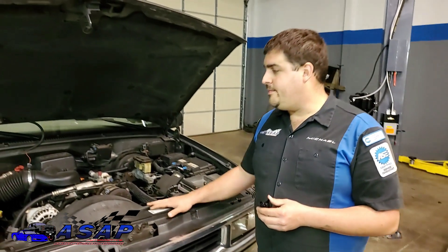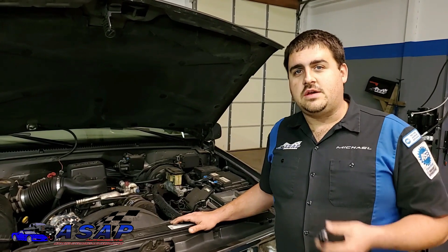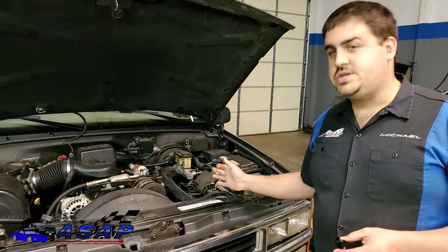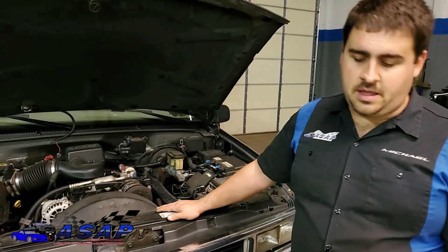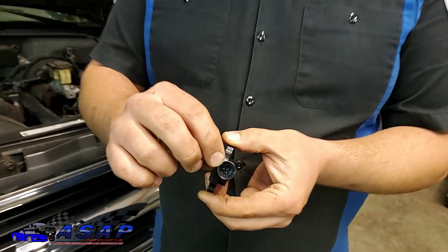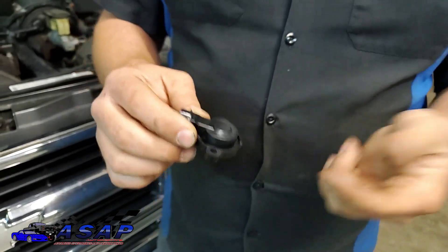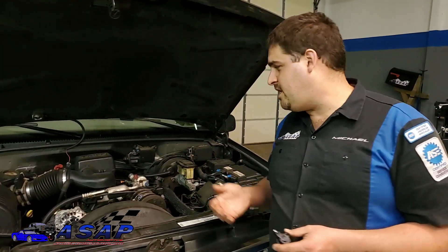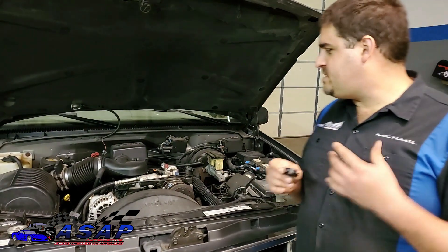So I wanted to make a quick little video for you guys. This will cover a lot of vehicles, kind of like some of the other stuff we're covering. Specifically we're dealing with my '99 Tahoe here with a 5.7 Vortec in it, and pretty much any of these Vortecs are the same. But basically most any of these serviceable TPS sensors are going to be about the same. You're typically going to have a three-wire connector and two, maybe three bolts holding it down. Your application might have some Phillips head screws, or it might be like ours — a Torx bit, maybe a T20 or T15, something like that.